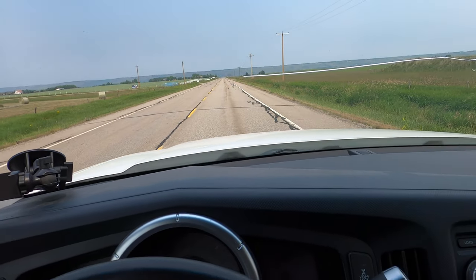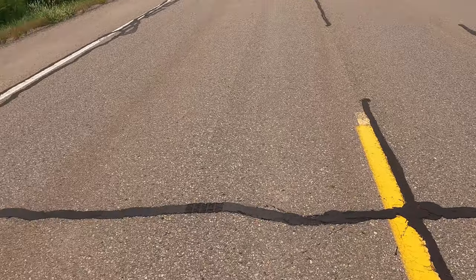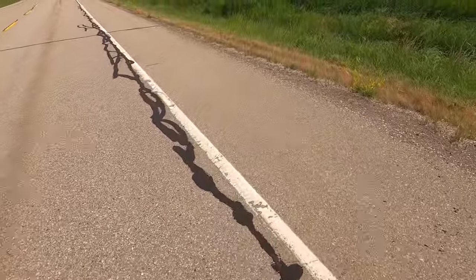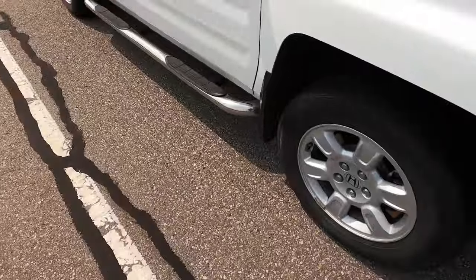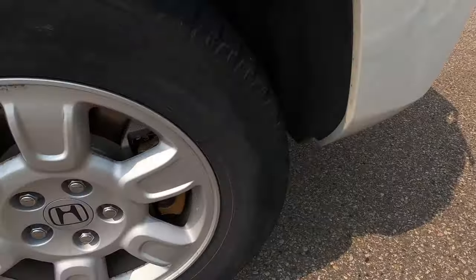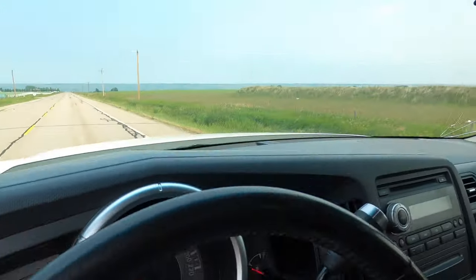And that definitely grabs harder. The ABS was going. There's rubber marks on the road. And up there is our red mark. I'm just gonna pace this off back to the truck. 1, 2, 3, 4, 5, 6, 7, 8, 9, 10 big steps, I'd say that's about 10 yards, so about 30 feet. Stopping distance we took off with that brake upgrade. So that's great, I'm impressed with that.